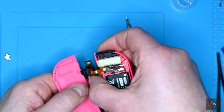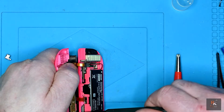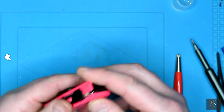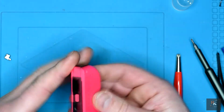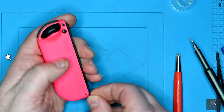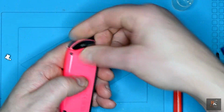First of all, this panel. Single screw there to retain it. And now carefully fold everything back over. Lining everything up, it should hopefully just clip together. Like so. And then back to the 4 screws, the tri-wings that we took out at the very beginning. Now obviously if you're replacing the battery, you can see you can do that without needing to disconnect anything.